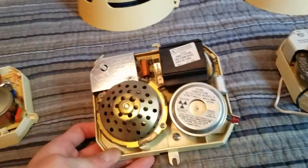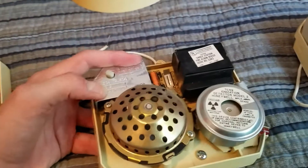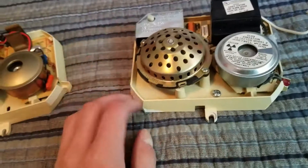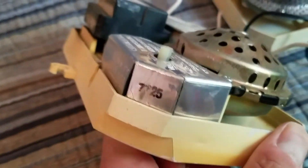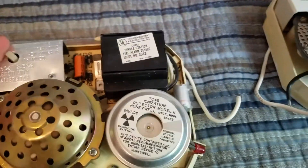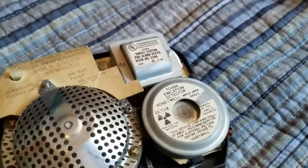You'll also notice that this one's circuitry cover is different - it has a metal circuitry cover, which I don't think I've seen before. It's an aluminum cover as opposed to the regular cardboard that these normally had, and even the 89B has. That leads me to believe this one is probably a slightly earlier model. This one is dated 1977 on the side - you can see 7725. The transformer in this one is also different; it's got a plastic housing over it. Normally we're used to seeing just a regular bare-bodied transformer with the UL label, but this one has a plastic housing with the UL label and no labels molded into the plastic.